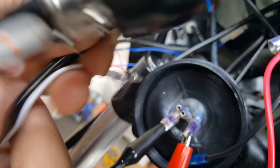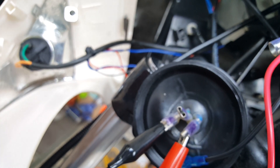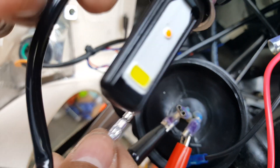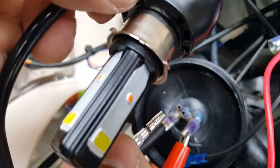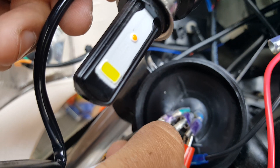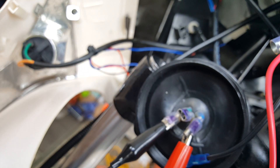My high beam was turned on — that's probably why. Let me turn off the scooter and just put the ignition key in the on position without starting it. My high beam was on, so that's why it said it couldn't give low beam — because you have your high beam toggled on, it won't give you the driving light. Let's see if the driving light comes on now. Still doesn't come on without the engine running, so this thing needs more power — the engine needs to crank over a certain voltage.